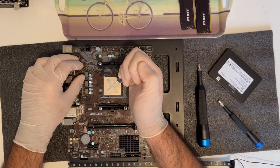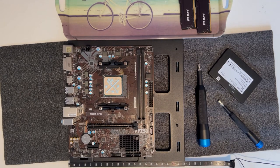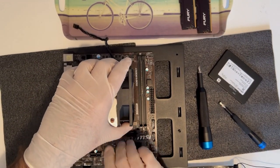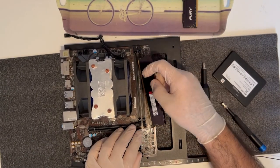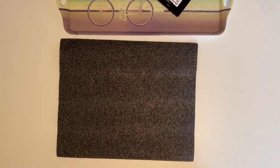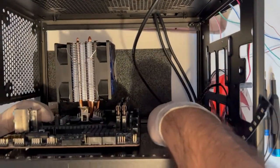This time it's an AMD build centered around the Ryzen 1300X, a 4-core 4-thread CPU housed in an A320 motherboard from MSI and paired with 16GB of DDR4 RAM running at 2400 MHz. Bit low for Ryzen, I know, but for budget builds the quantity is far more important than the speed. Cooling the CPU is a cooler brand I've never seen before, but with two heat pipes and two 80mm fans it keeps the CPU in check very well, with temperatures peaking around 68°C with the fans running at 5V. The motherboard only does PWM control, which is a bit annoying in a budget board. My heartfelt congratulations to the chap that designed the clamping mechanism — he made a robust clamp somehow feel cheap. It provides decent mounting pressure and is robust, but at the same time gives you a very funny uneasy feeling, like it's gonna snap or explode at any moment.